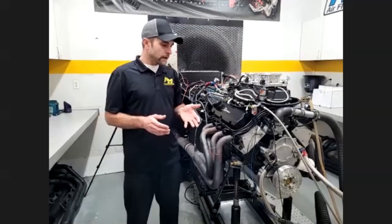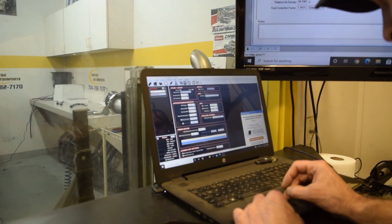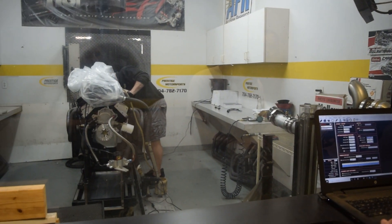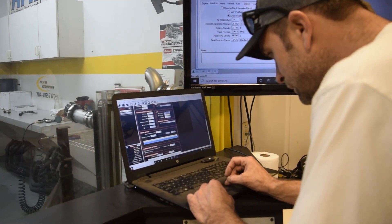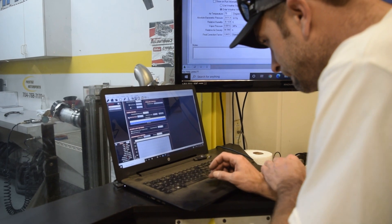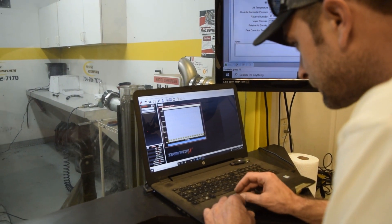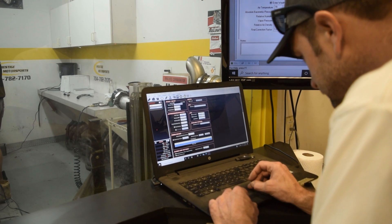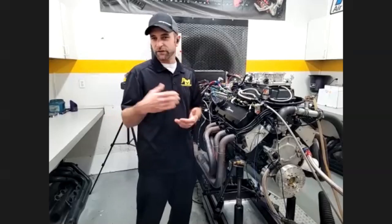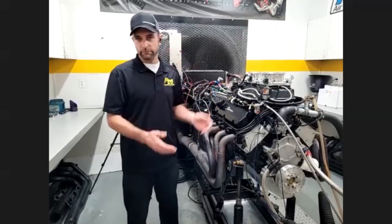If we had a carbureted engine that is nitrous fed, we're going to have to have a pretty expensive ignition box — something that removes the timing when we're on nitrous, so we don't have to just adjust the timing statically and lose all the power until we're on the nitrous. We also need something to control the nitrous, such as progressive control in most cases. The Holley is going to provide all of those functions in one simple box at a very good price, and you could still squirt the fuel in with a carburetor if you want. And if a buddy talks you into fuel injection in the future — bam, it's all there, you already have it.